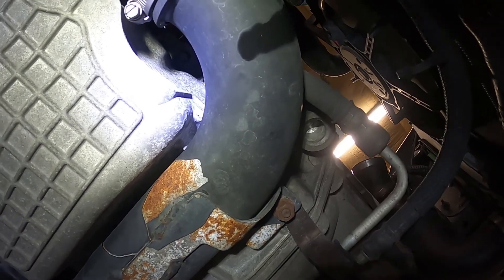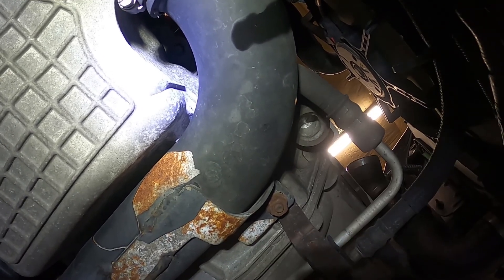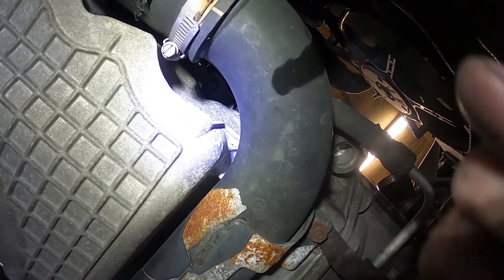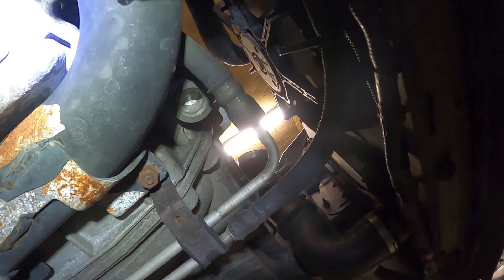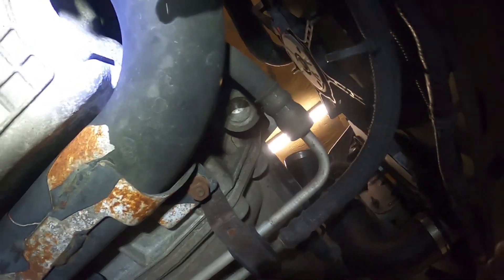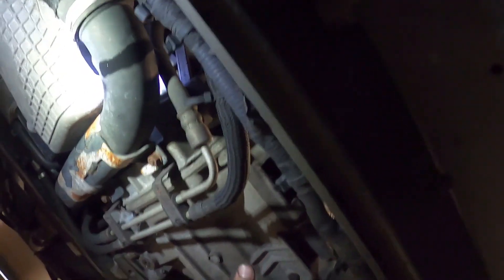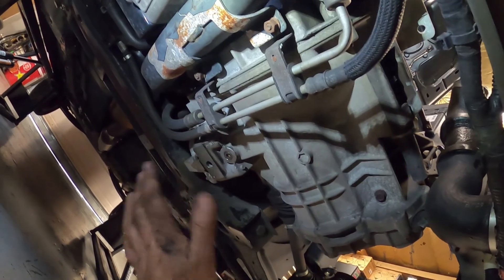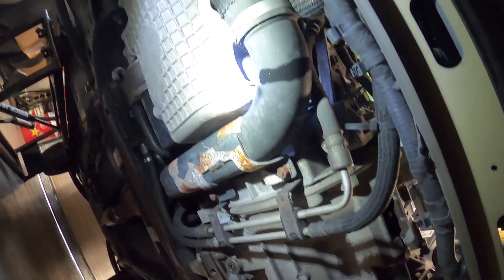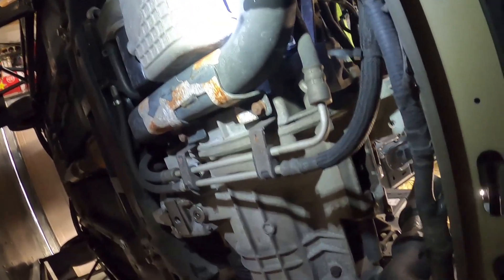This car has the factory modular clutch - it's kind of like a torque converter. There are four bolts on that. We're going to turn the crank and break those loose while it's still supported, so that when we remove the transmission it comes off and the clutch stays in the transmission like a torque converter would. We're putting the ACT in, so the hardest part of the whole job is getting the transmission back up over the clutch and lined up because the diff hits the suspension. The last couple I've done I got in pretty easy though.